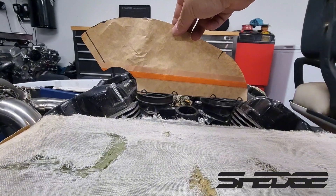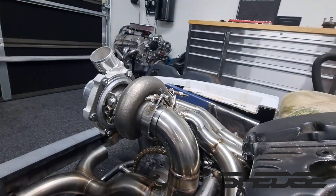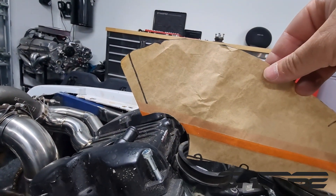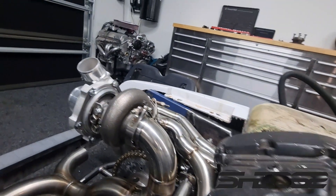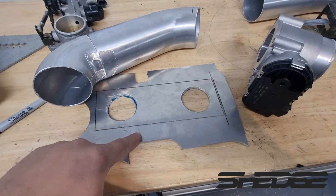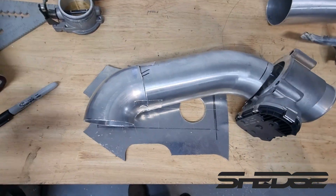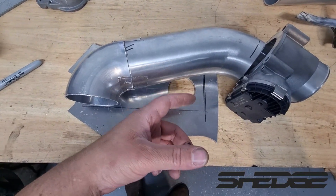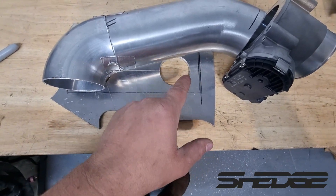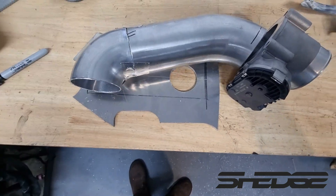Here's the rough shape. This angle here we need to adjust because we want it to come out of the turbo parallel and then just kick up slightly, instead of dropping down and coming back up. You want that nice flow - something like that. Here goes the base roughed out with these tubes. To make up the missing void we'll use a bit of flat aluminium sheet, cut another radius so it tucks up nicely, follows the curvature, a little bit of flat across and that should fill it up.